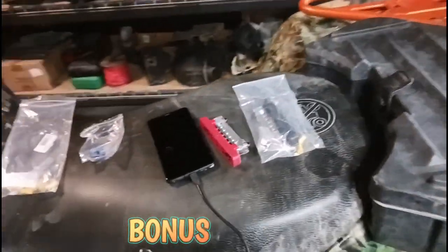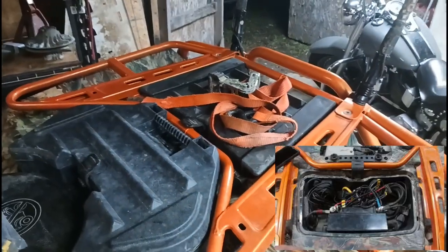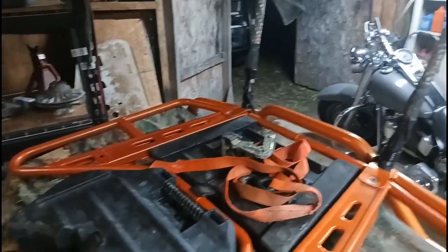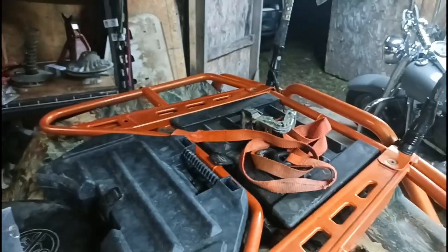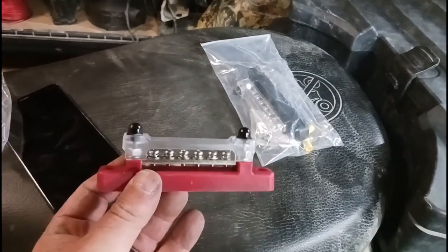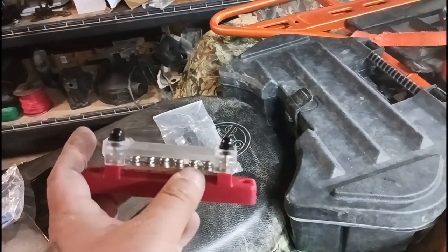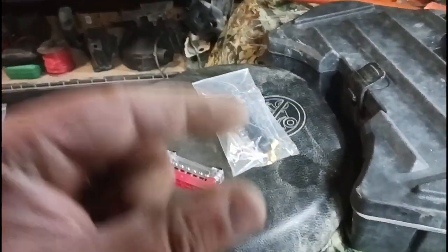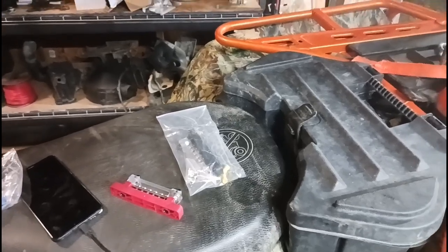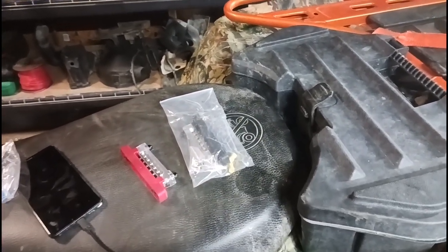If you've been following my channel, in the last video I installed a secondary battery — I have two batteries on this machine, one underneath in the factory location and one inside this box. With the accessories — the light bars, the rock lights, etc. — I have multiple terminals stacked up on top of the battery terminal, and I don't like that at all. So I got these new bus bars in and I'm going to install those in the secondary battery area so I can run each connection off a bus bar rather than stacking four or five plugs on one battery terminal — it's not safe and worst case can cause a fire. Stay tuned for that on my next video.